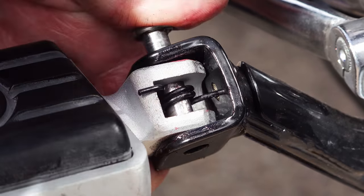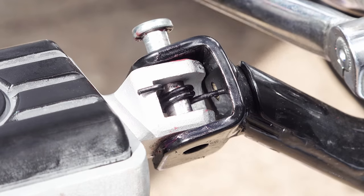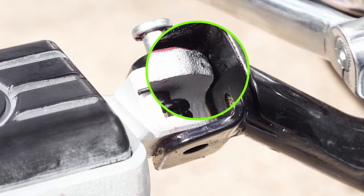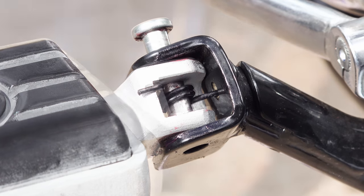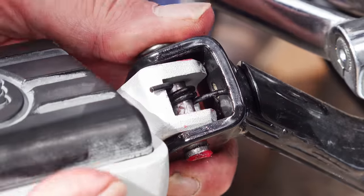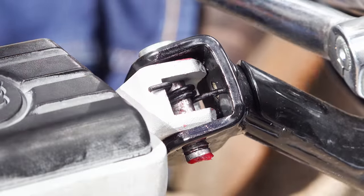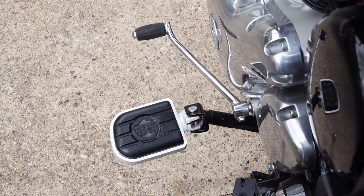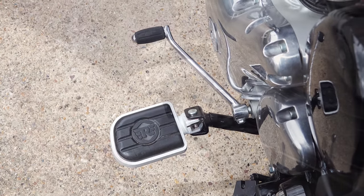As you can see, the ends of the footpeg itself are cut at an angle. I was having trouble getting the pin all the way through because I was holding the footpeg straight. I thought this might be a manufacturing fault and was tempted to file the leading edge to even it up, but I held off because I thought it might be intentional — and I do think it is intentional. Once you get the bottom hole lined up, this footpeg sits at a slight angle. At first it looks wrong to the eye, but it actually makes perfect sense once you start riding the bike.